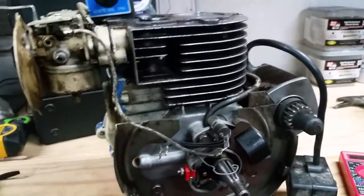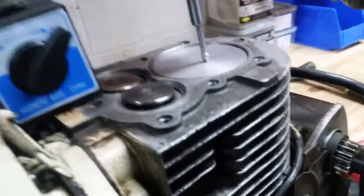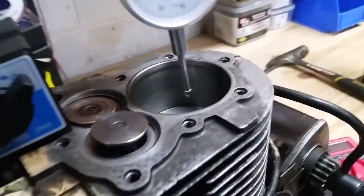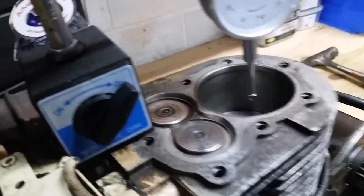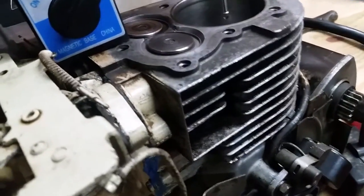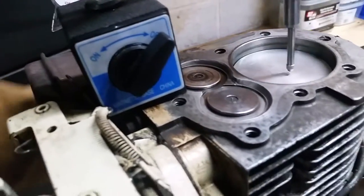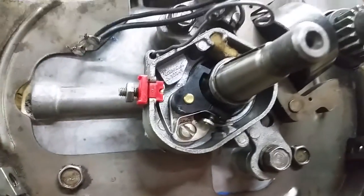This Tecumseh has a timing dimension of 80 thousandths, or 0.080. What that means is 0.080 before top dead center — BTDC. So you have to find the direction your engine will be turning and turn it in that direction. That eliminates the play or backlash within the crankshaft, connecting rod, and piston cylinder. You measure 80 thousandths before you hit top dead center of the piston, and at that point you want that contactor to just start to open — that will set your timing.